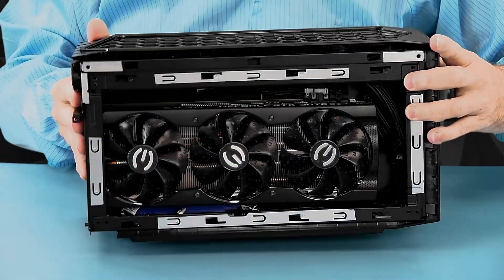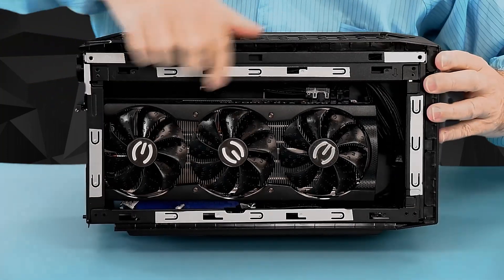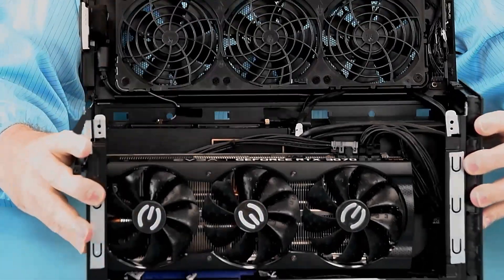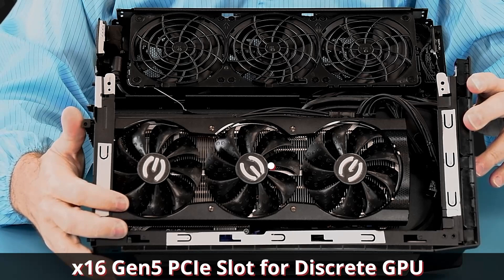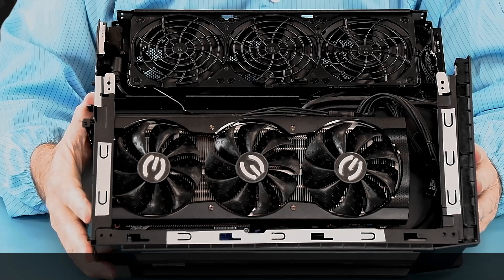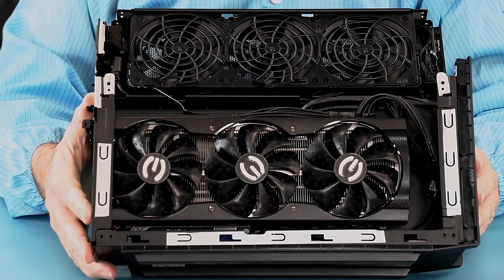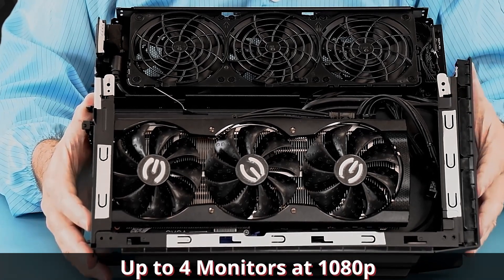Opening the top, you can see the word 'pull' here. You pull towards you and it just tilts up. Now you can see that I have a graphics card installed. The Eden Bay compute element of the Alder Lake drives three 4K 60Hz monitors. Even though you can physically attach five monitors to the base card, only three of them would be active unless you have a GPU plugged in to give you additional display drivers.